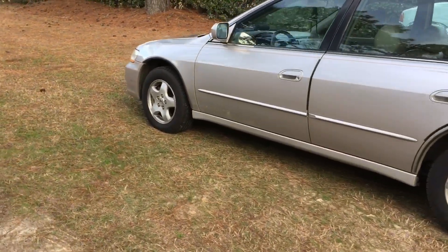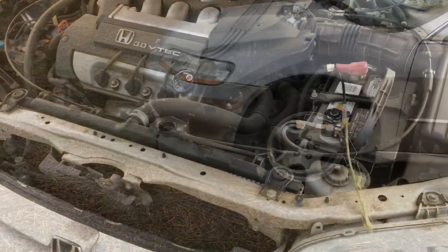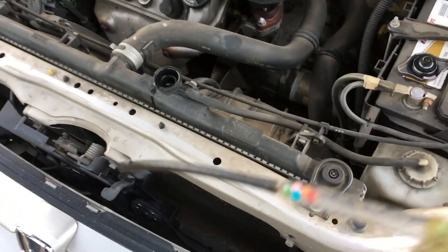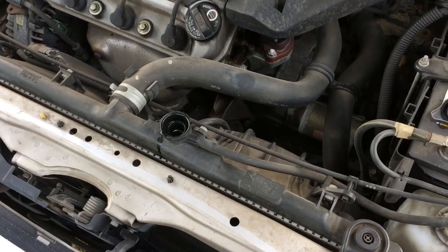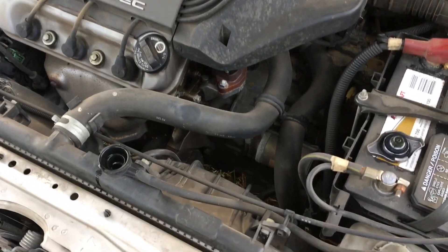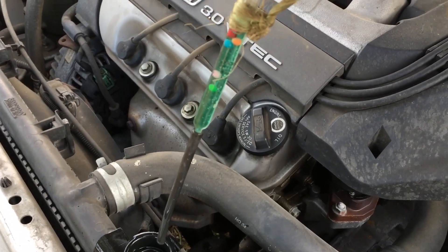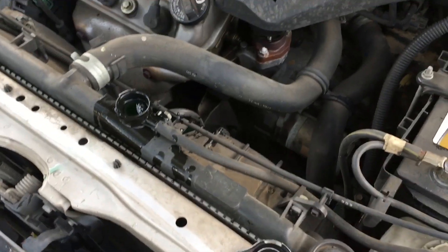Here's the little Honda that my son drives back and forth to welding school — we're fixing to check it out. We took the radiator cap off; it was just down enough in the reservoir that I couldn't suck it up with the tester, so I added probably half a quart. Now I've got to let it heat up and mix in so when I check it, I won't just be checking the antifreeze right on top. We'll be right back in a minute. She's gonna float all five balls — I think that's good.